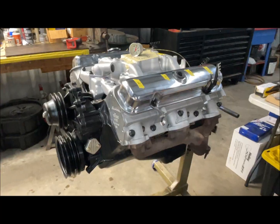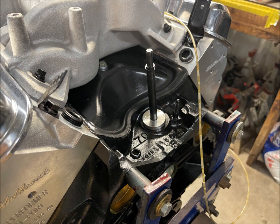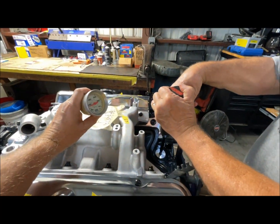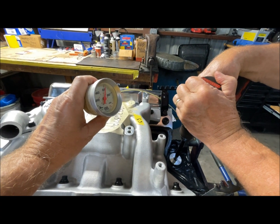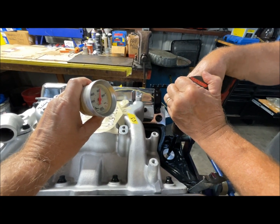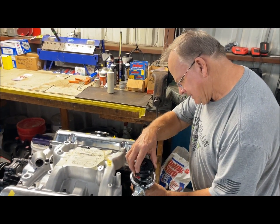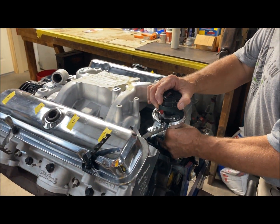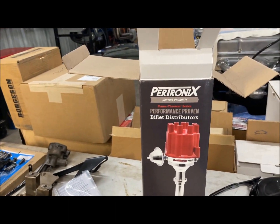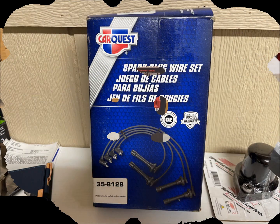Pontiacs run in the opposite direction, which is one key difference for this build. He then primed the oil pump and hooked up a manual oil gauge and drill to verify oil pressure and check for oil leaks. The distributor went in next — another difference — this one has dual sets of points, which is important regarding the coil and electrical.